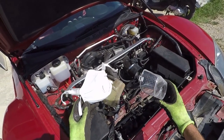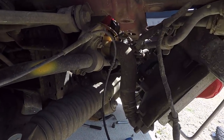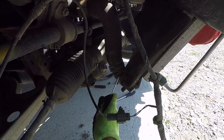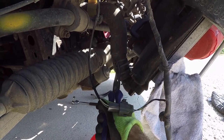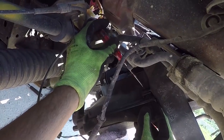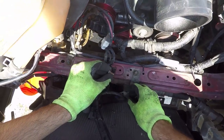For the next part, if you choose to work under the car, I suggest you get some safety glasses and something to cover your mouth in case coolant spills out. But if you're willing to make some extra effort by turning the wheels all the way to the right and removing the front bumper and side wheel vent behind it, you will make the whole process a million times easier and safer. Take your bent nose pliers and slide up the clamp on the lower radiator hose. Take a hose pick and work it on the internal part of the hose to get it loose. Put a pan under the hose in case coolant spills out. Squeeze the clamp with your bent nose pliers and pull it upwards by wiggling it left and right — and with minimal effort, the hose will be removed. Unclip the bottom plastic clamp holding the wire harness in place. Take a screwdriver and remove the plastic bolt holding the battery air duct in place and take it out. Use a ratchet with 10mm socket to remove the bolt holding the negative terminal of the harness in place and take it out.